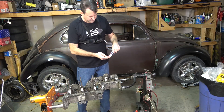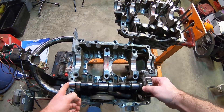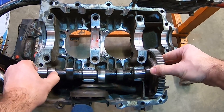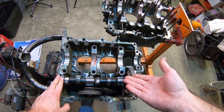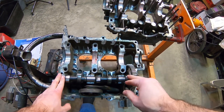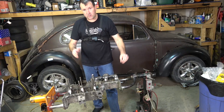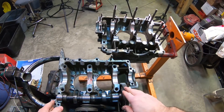Now we'll use real oil and refit the camshaft. Now it spins around - you can hear that little clunk. What will happen if you don't do this: if you push the camshaft in with that bearing too tight and go to spin it, it'll actually spin that bearing right out of the case, and then you'll know you have a problem.